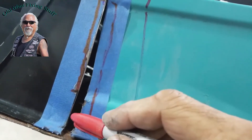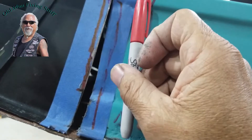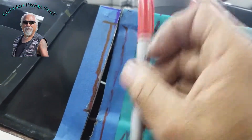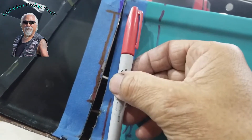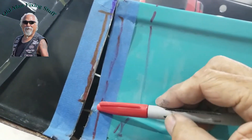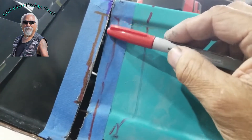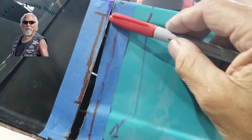I've got to fill this piece — cut off just a quarter inch, so I'll have to add that in. I'm going to add in a much bigger piece, about twice of what I need. Add it in further. I'm going to ball-peen this down — dolly and hammer it — and then bend it up so it's got the same edge, as close as I can get to it.